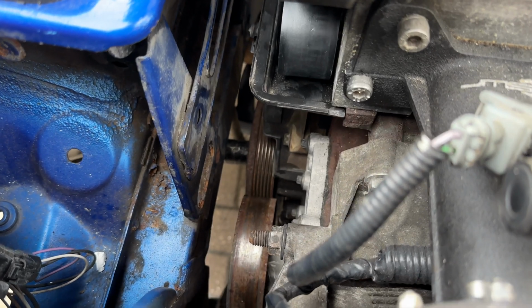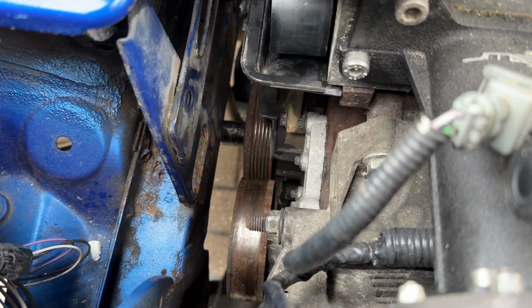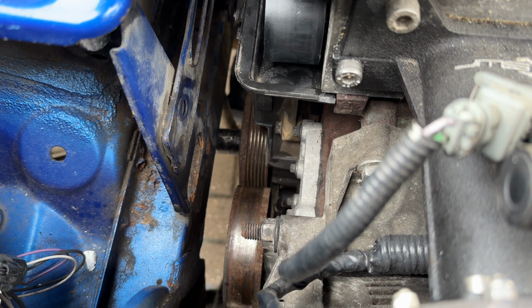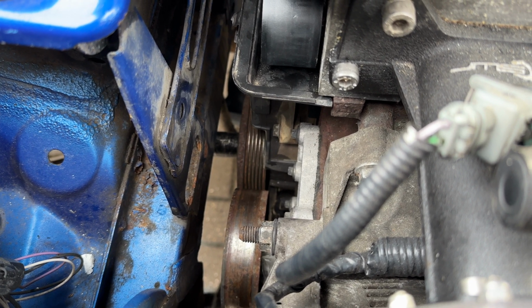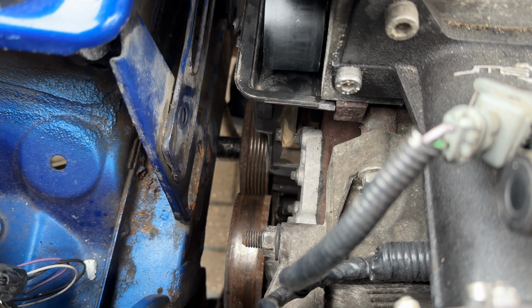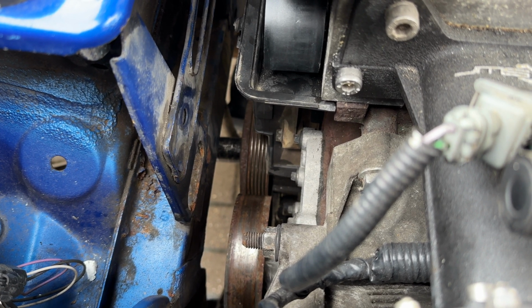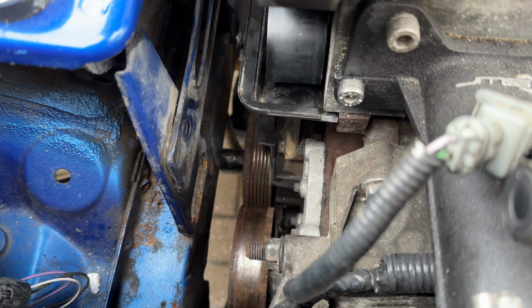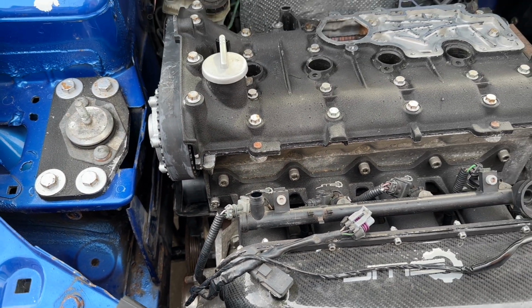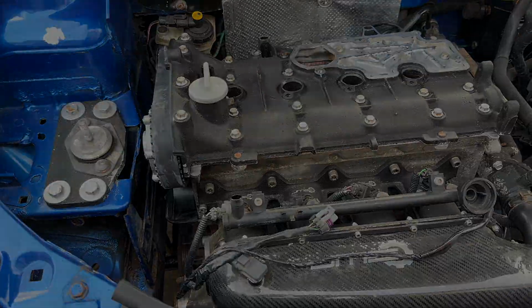As hopefully you can see down the bottom there, I've set up my angle gauge. We need to go for 115 degrees on top of the 20 Newton meters I've just applied. So there is a 15-degree tolerance on there, minus or plus, but we'll go for 115. It will be quite difficult to do. If you've got a fancy Snap-on wrench, it will tell you in degrees without having to use the angle gauge. But I've gone old school and it's going to hopefully work for us today.